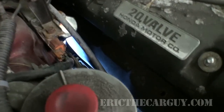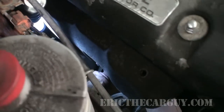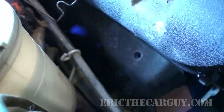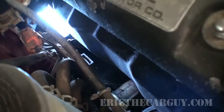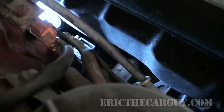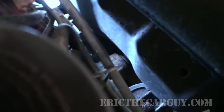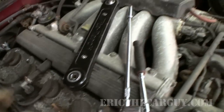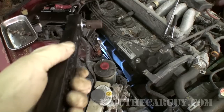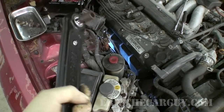I've done a little bit of pre-preparation here. What I'm trying to do is remove a heat shield that goes above the exhaust manifold. I suspect there's a crack in that exhaust manifold and I want to get a look at it. I've already removed the upper fasteners, which are somewhat easy to access. But there is yet another fastener further down that I'd like to remove — you can see it right there. It's a perfect candidate to use for this. Normally that fastener is a 12 millimeter, but unfortunately it has rusted away and I'm able to get an 11 millimeter on it. I have my tool set up with my 11 millimeter socket and the 3/8 extender, and I'm going to put this down inside there and try to break it loose with the tight reach tool.